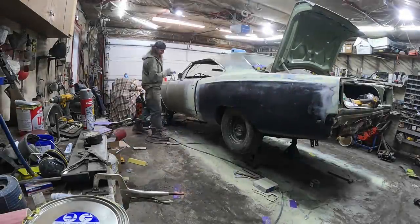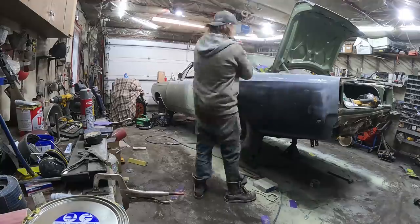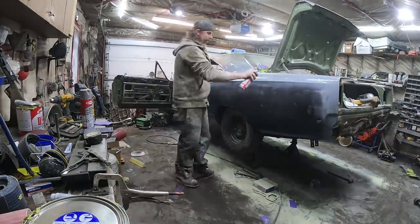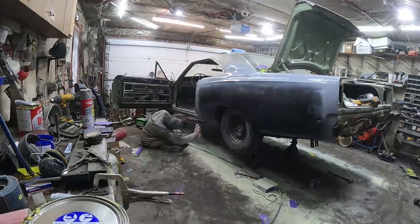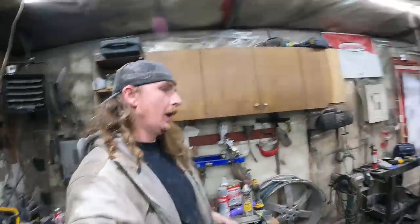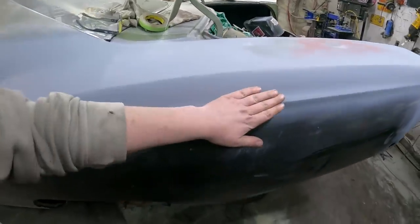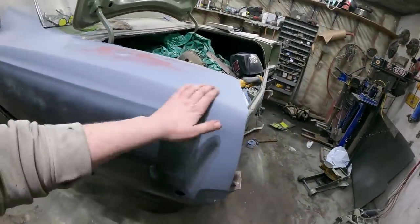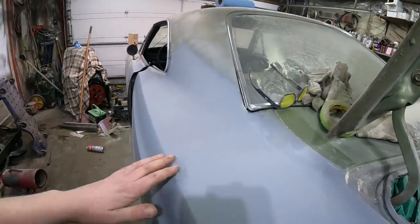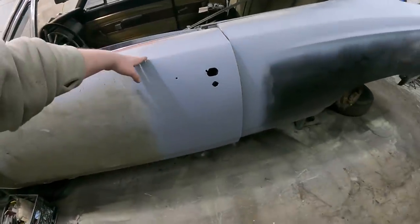It's the next day. I have to charge the camera today — and I bought a long extension cord for it. Where we left yesterday, I had fogged the bodywork with some high build primer and we're doing pretty good. I'm gonna hit this just a couple more times, gonna sand it, leave the top kind of rough. Flat primer hides a lot but it does look not too bad, and when it was wet it came out pretty decent — happy enough with it. Same with the door, the door came out pretty decent.